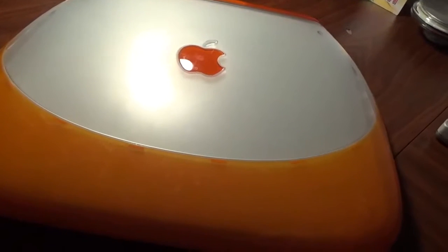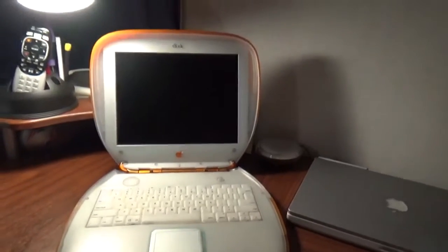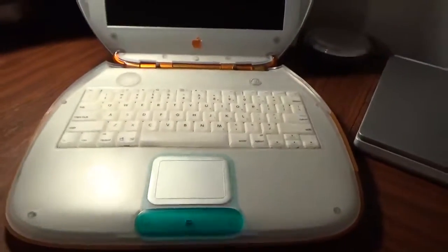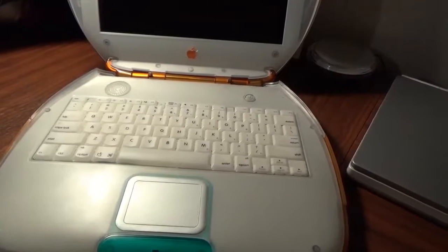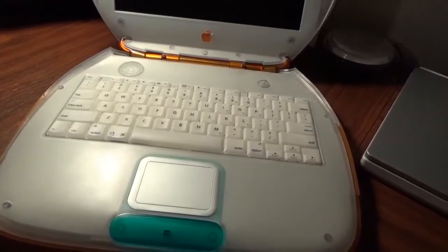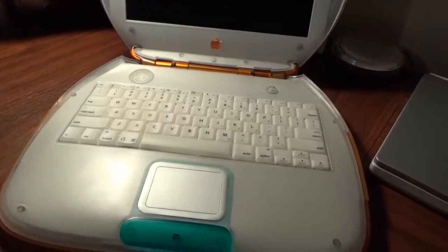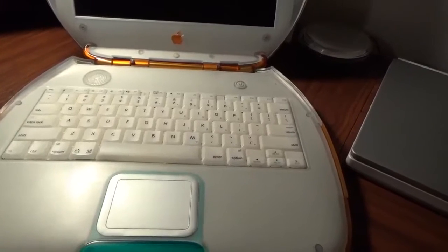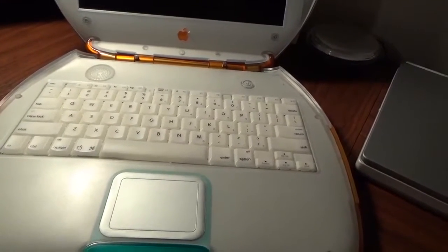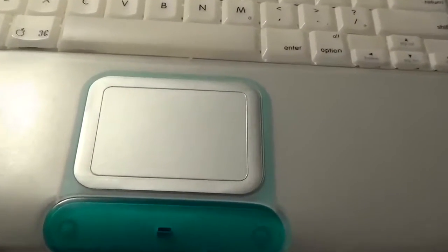Let's go ahead and open it up. As you'll notice, there's no latch — it works just like a flip phone. You can see some of the work I've done here. I had to put a new top case on, and color-matching parts for these computers are getting a little hard to find. One of the great things about the clamshells is there were no major changes across the entire series, so you can mix and match different color parts from different iBooks and create a multi-colored iBook.